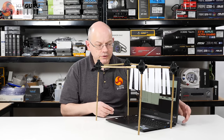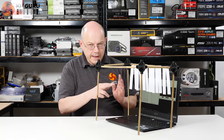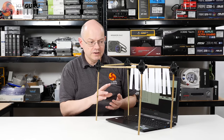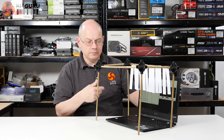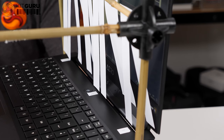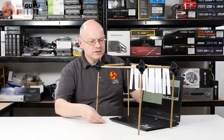Now for the exhaust: I can't run a full stress test here because the power cord would interfere with my frame, so instead I'm using the function keys to run the fans at full blast. This means the expelled air is cold rather than hot — it's close enough but not identical to the real scenario. I'll hold the laptop up and move it towards the paper. And again, it's absolutely at the ends — directly above the two fans — where you see the paper moving. In the middle, almost nothing is going on.